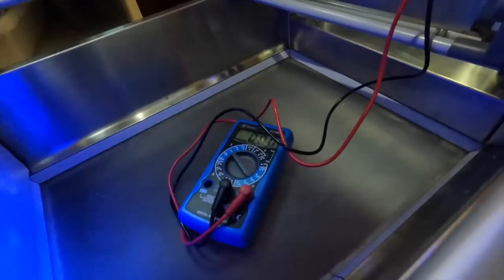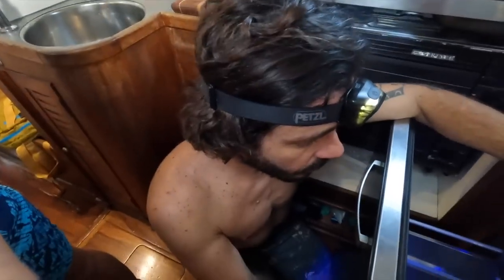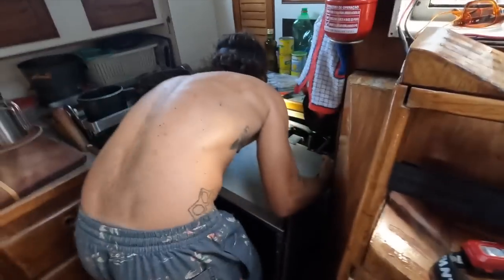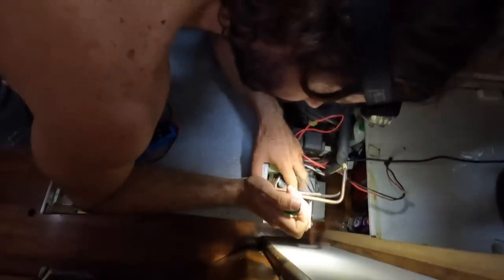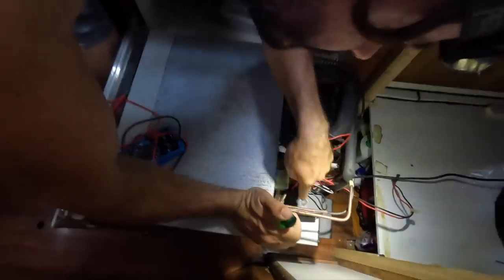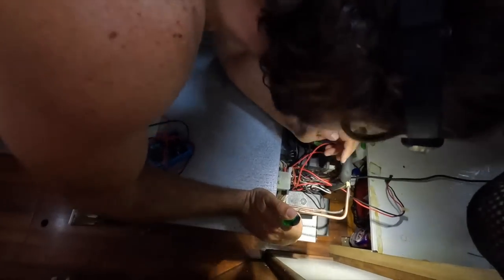No — there is no energy arriving at the cooler fan. The cooler fan itself is not the problem, but the wire for the cooler might be the problem. We need to take out this little box to check where the wire goes, because it comes from here and goes inside the box and then I have no idea where it goes.